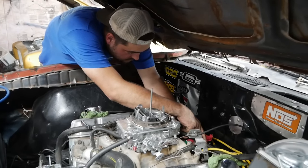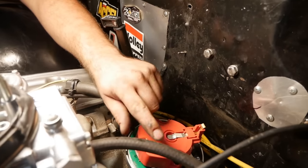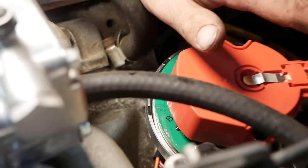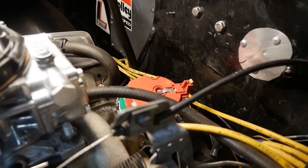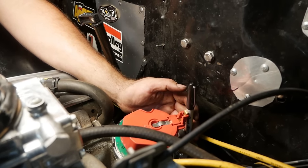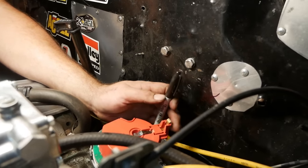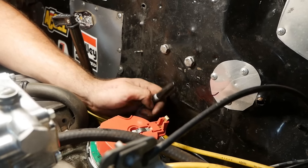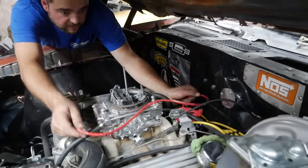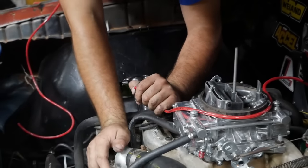The next step changes things up. You see these black marks on top of the housing — you rotate the distributor housing until one of these marks is aligned with the rotor, and that's going to put it at 10 degrees. I held my sharpie up to check alignment, then made a mark on the outside of the distributor housing so this is now number one. You do have to hook up a vacuum signal to this thing — full manifold vacuum source — and this intake port right here will make a good vacuum source for it.